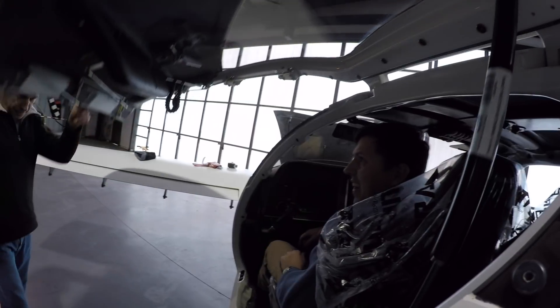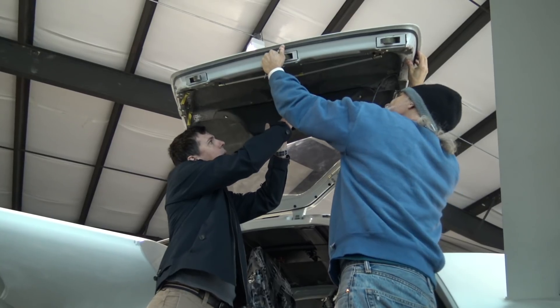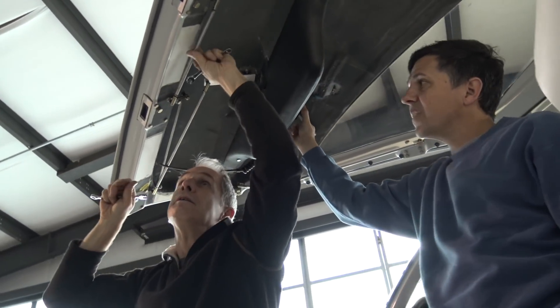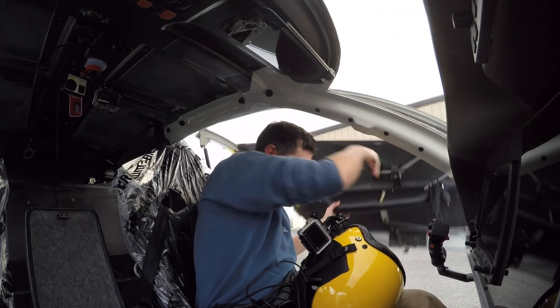The other issue was the main cabin doors. There are two very large gull-wing style doors on both sides of the fuselage. The latch mechanism is designed for pressurization — it has sets of pins that run forward and aft into the fuselage out of the door to take pressurization loads. On the bottom of the door are hooks: two go one direction and the other hooks the other way, giving a self-reacting force. The problem was the aft hook on the pilot door wasn't retracting enough, so you couldn't open the door once it was fully latched. The biggest concern being if you need to jump out of the airplane, you're probably not going to get the door open. So Peter is going to stiffen up the system and make it more consistent.